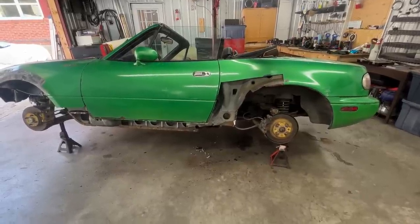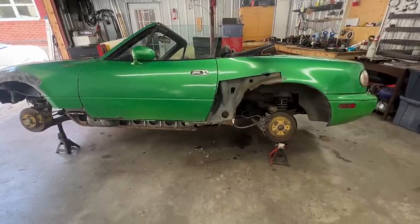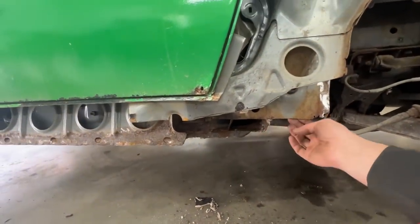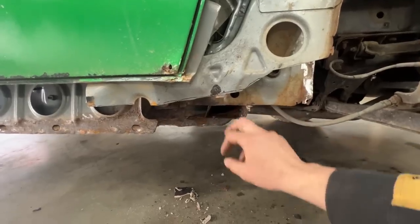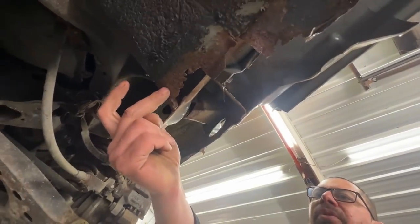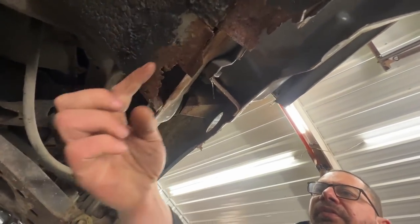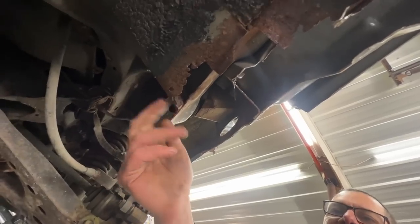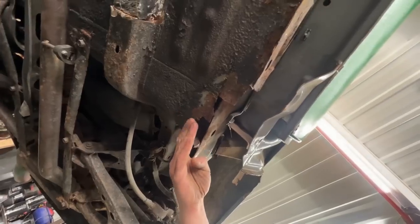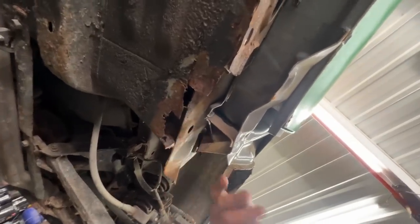Or cutting a little bit more before we start putting stuff together, because here, before we start building up the missing part, we still need to cut more. I just went underneath and I buzzed a little bit with the needle scaler, and it looks like here we have to still cut further and start repairing this channel that comes from somewhere there and build it up to here, and then we can start building up the front parts here.